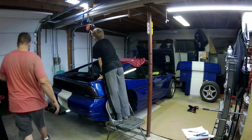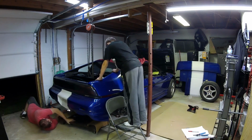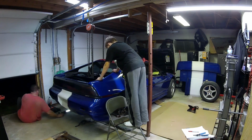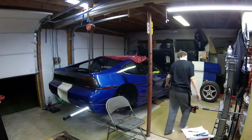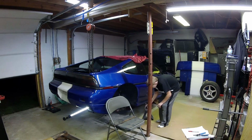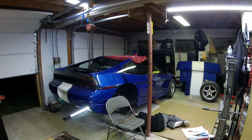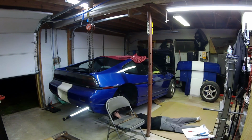All right. How much up do you have? That is the cradle and the whole car completely suspended. Now I need to go out so I can get the jack stand. Get your jack stand, see how I got mine? Be careful, because the end of it can come right out. Carry it by the handle. And sit it under the car, right under the frame rail. See where I got mine? Now turn it 90 degrees. There you go. Flat. You're in. Now go let the car down on top of it, and we're done.